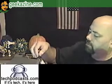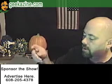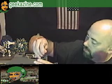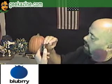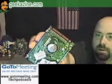The one thing that a lot of people think is that doing all this tech is so difficult. It's just common sense. Like for instance, okay, we put this ribbon on. Now, if I was to try and pull this off, these Dell ribbons can have a tendency of actually bending pins. So instead of just willy-nilly taking it off, I'll take a small screwdriver and I'll actually pry it off, ever so gently. I'll take it to the edges. I'll lift up a little bit, and I'll take it to the middle, and I'll walk it on down until I can start seeing pins, and then I'll walk it back, being ever so gentle, not to pull the pins. Because if you bend a pin, that can be bad. As you can see, all the pins should be, or are, in the same configuration that they were. It's really not that difficult. You want to give it a try, go for it.